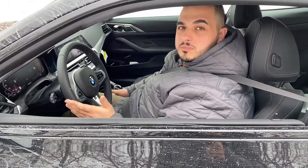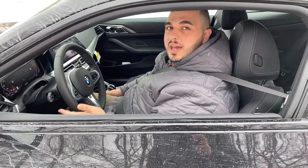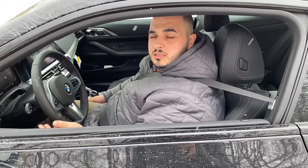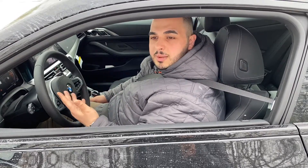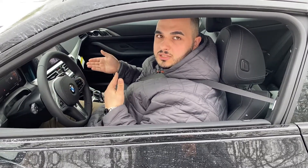We're just going to talk about BMW's all-wheel drive system. BMW's all-wheel drive system, aka xDrive, is an electronically controlled all-wheel drive system. Mainly it's going to be a rear-wheel-drive bias, but it will also send power to the front wheels as needed based on weather conditions and how you're accelerating the vehicle. The majority of power will be sent to the rear wheels and then can be sent to the front or any other wheel based on how it needs to be.